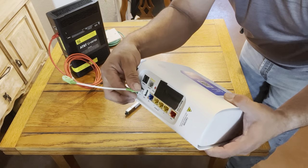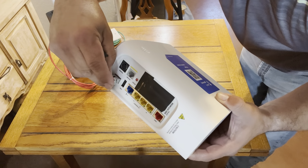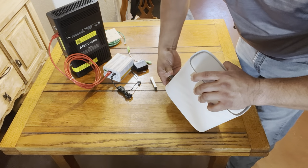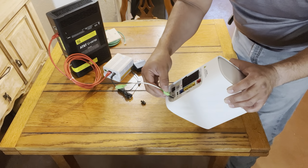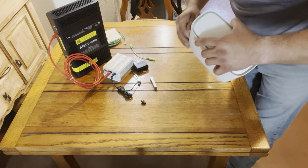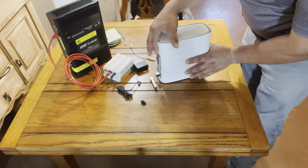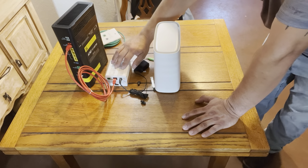For the green SFP, to remove it there's a little lever — just lift that and it comes right out. To insert the green SFP, plug it in and you should hear it click — there it goes. Remove the little buffer plug, plug the fiber into the wall jack, and once you've got all that set up, you activate the gateway the same way through the Smart Home Manager app.